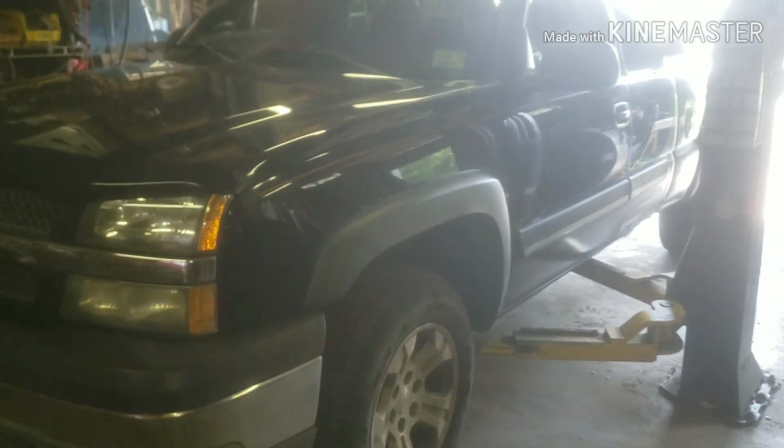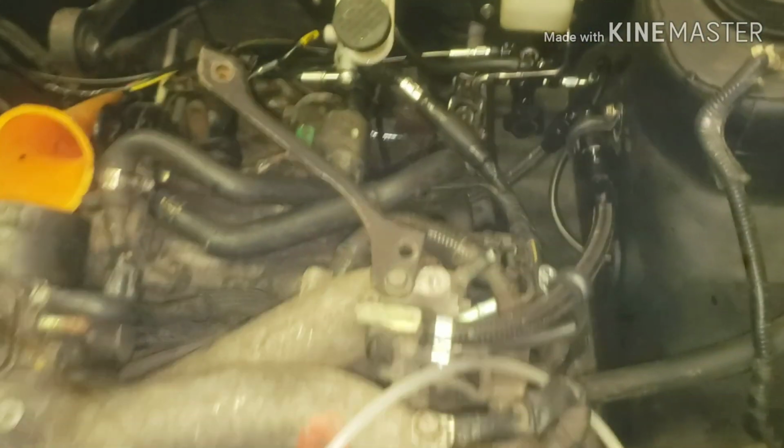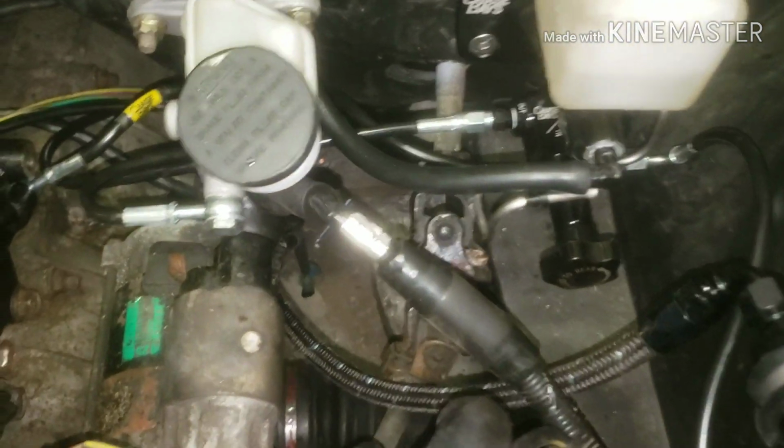Alright guys, my buddy's Chevy blew, well, he wore the brake pads down so low that the piston seal on the caliper blew out. So this thing's taking up the lift bay. I didn't want to come here and do nothing. I had to do parking brake hardware on my Impreza because the spring at the bottom of the shoe was rubbing on the ABS tone ring.